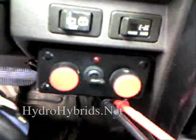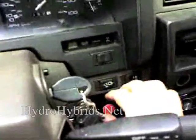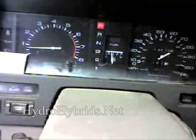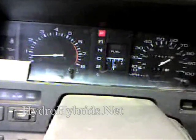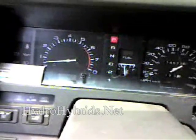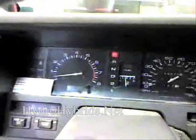You can see I'm actually going to adjust the MAF sensor here, which is right down here. As I turn this down, we're going to lean the truck out. Watch the RPMs there. We're leaning the truck out now to where it's hardly getting any fuel at all. Hardly any gasoline getting to this truck at all now.